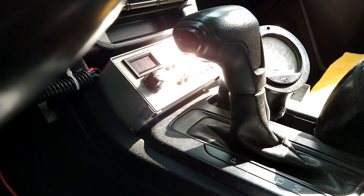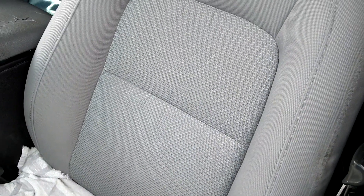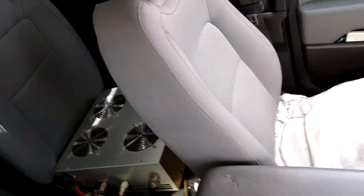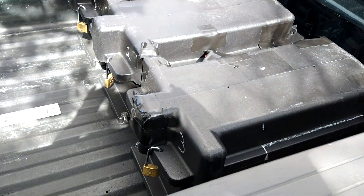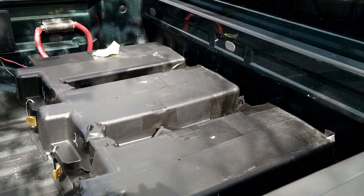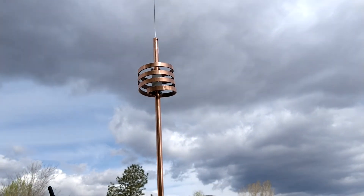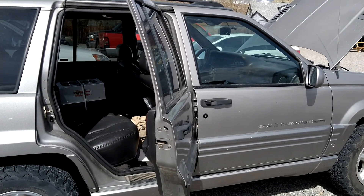There's his regulator where he can control his voltage - turn it up or down for his amplifier. He's got his two-by amplifier currently behind the back seat. He's got the line section for the bird meters. 815's got a badass little setup - he's definitely a skip talker. He's got his batteries back in his bed to power everything. And the best part - look at this beautiful antenna, a one-off all-copper Mr. Coily right there.